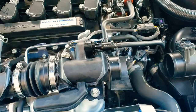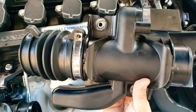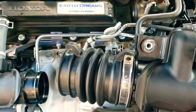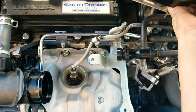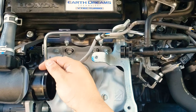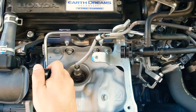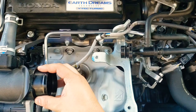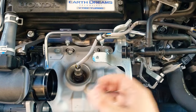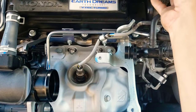I'm gonna remove the rest of this to remove the whole bracket. Now, removing this hose piece is a mission. What I ended up doing is sticking a screwdriver in here very carefully, without ripping the hose — it kind of tucks because it's been on here so long it stays stuck. I used the screwdriver to move it a little, and once that hose was off this part came off easily.